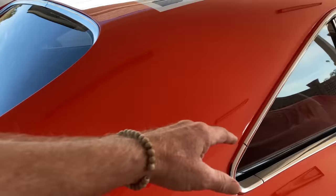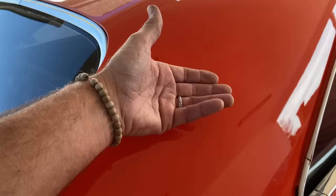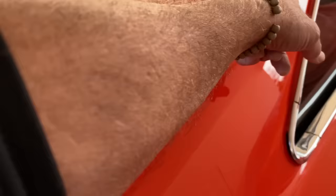There's a seam right here that Chrysler never bothered to cover up because every single one of these cars had a vinyl top. They were two-tone — usually black on top, then green, white, yellow, or whatever color below. They didn't bother with body work or filler here because it was covered up. That's why water gets caught in there and it rusts out eventually.